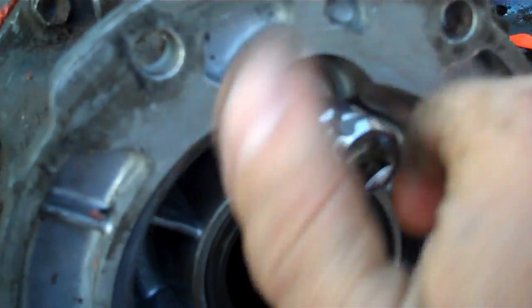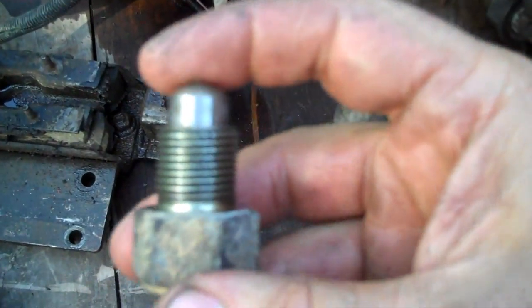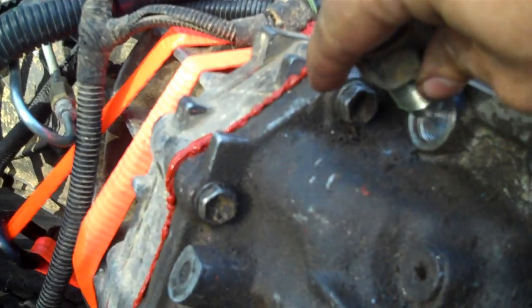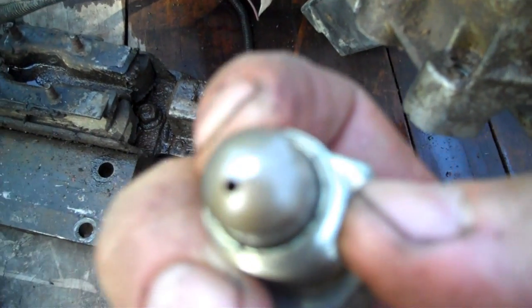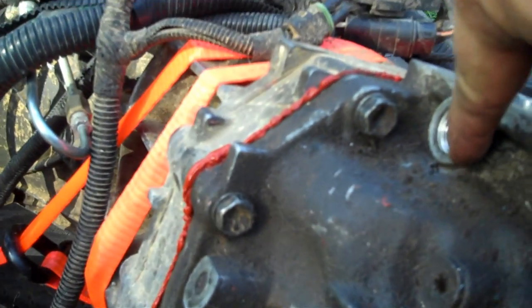After you've got that bolt tight, run that in and snug it up good. Then we put these centering spring assemblies in. Now we've got to put this right here — it's what centers your shifter every time you go from second to third. They go in right here. Before you stick them in, take and squeeze that top down right there — it compresses the spring. You want to make sure it's nice and smooth and not sticking anywhere. Both of these are in great shape. If they're sticking, I'd suggest soaking them in something to see if they unstick. These are good so they go in there — just tighten them up good.